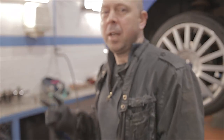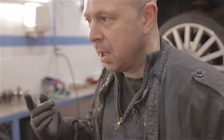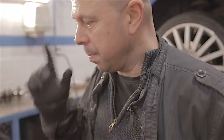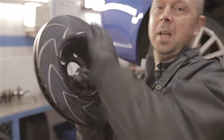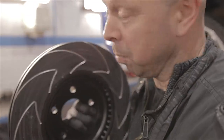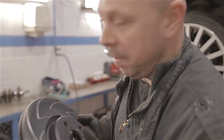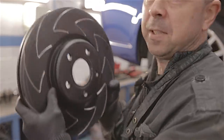We're going to get the clutch done this week, but before I go ahead there are a few things I want to clear up and a few corrections to make. First up, these discs — someone left a comment that the lines are on the wrong way around, that these discs are on the wrong way around. I got on Google and there is so much conflicting information out there, but I've come to the conclusion — and I forget his name — he was right. These arrows should face forward.